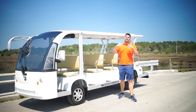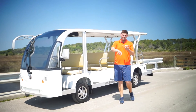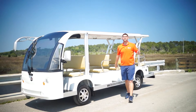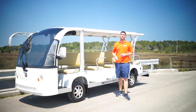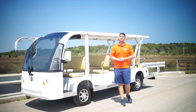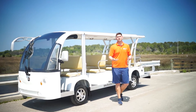We've had it for our golf carts, and customers have asked for something that goes further, lasts longer, less maintenance, it's lighter — maintenance free. The lithium battery is where it's at. It goes up to 100 miles on a charge. You can double parallel the packs to get up to 200 miles, versus the 30 to 50 miles that we're all used to on the lead acid batteries that also take maintenance once a month.